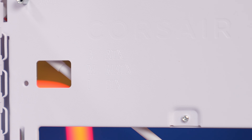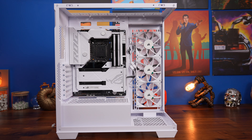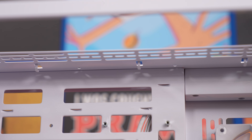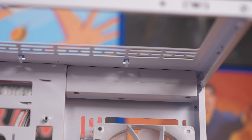Remove the little accessories box — I'll show you what's in there later on. You'll note there are markings on the case showing it supports ATX, MATX, and ITX motherboards. You've got an ITX motherboard, an ATX motherboard, and you can also fit an EATX motherboard. The standoffs allow for installation of these various sizes, although we're going to end up with an ATX RearConnect.